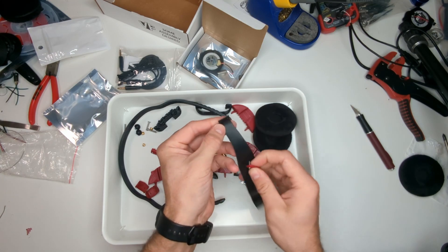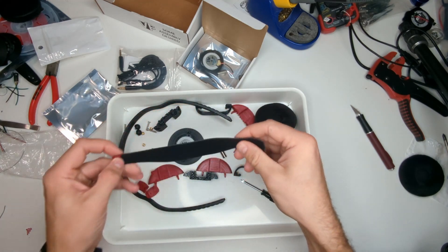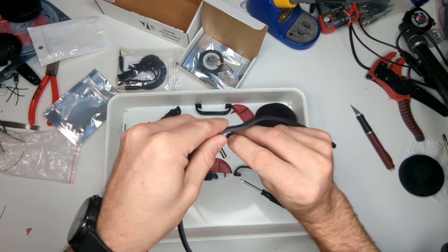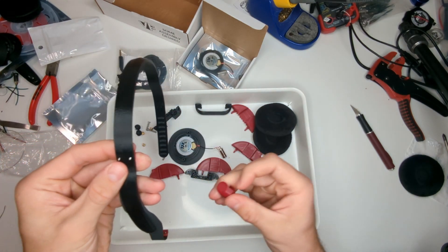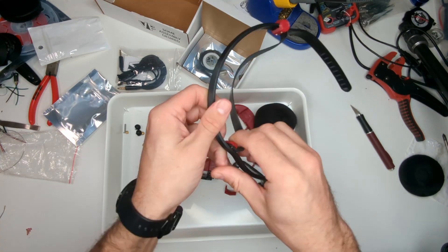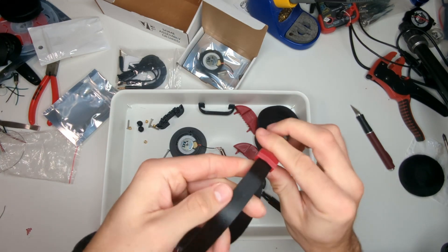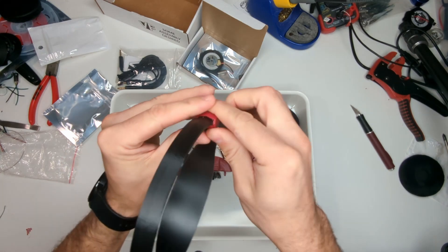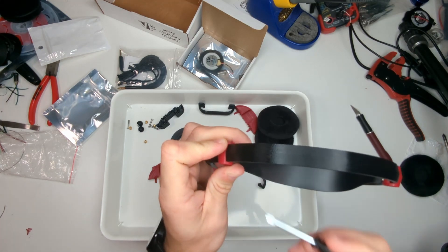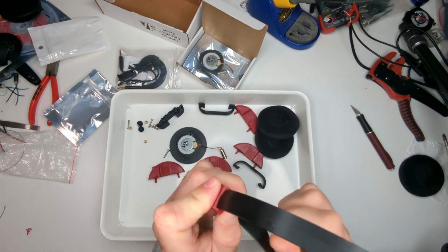You need to be careful — the leather does need to be flipped up in kind of a mustache shape. Stick the screws through there and get one side ready to go. They should hang on without too much trouble. Then push that through the headband spring, and you'll see the screws poke out the other side. Grab the headband covers and slide them over top, making sure the screws line up. Sometimes I'll look through the bottom to make sure I'm getting the screws into the holes. Match up both sides. As you're fastening these down, watch the gap on the headband — as soon as that gap is closed, you can stop. If you thread too far and find yourself stripping that cover, you can always print yourself a new one.